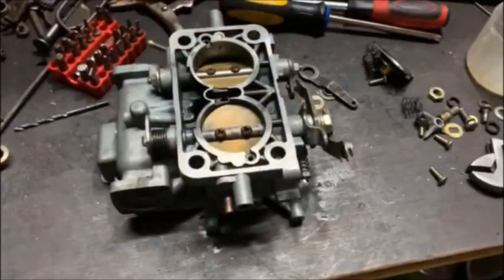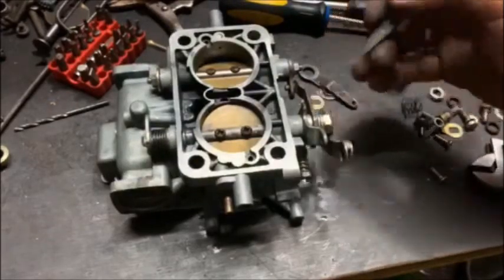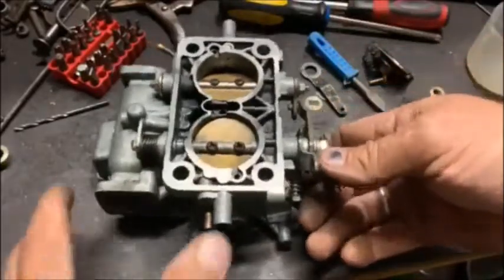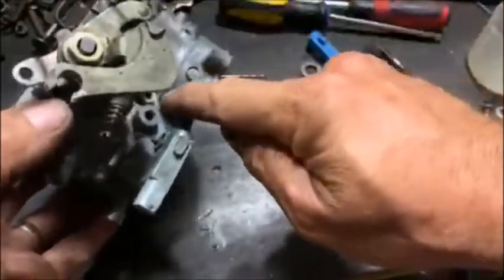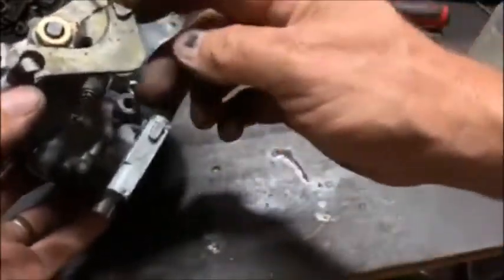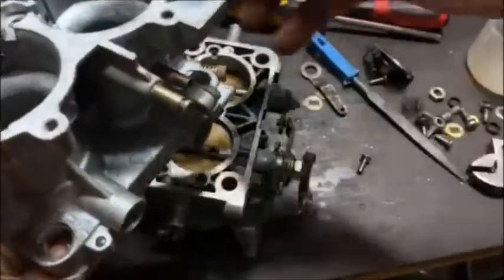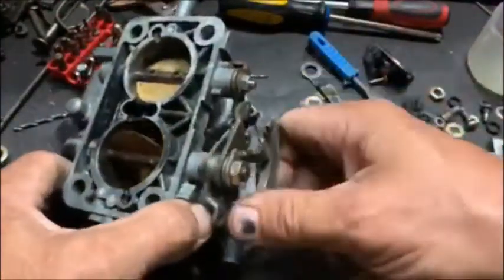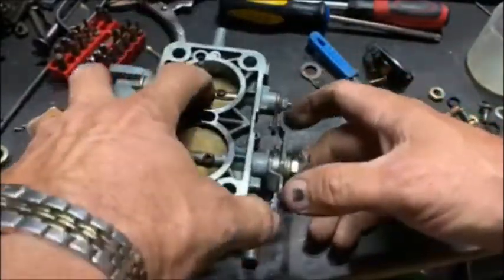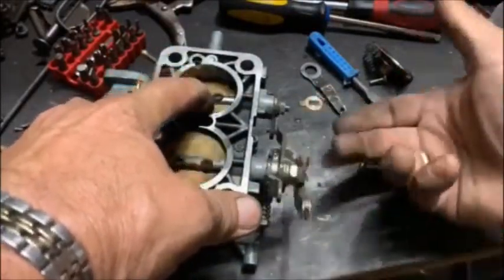On the other side, I've made that little spacer shorter — it's behind there now — and I've put this on just to see how it'll work. So far so good. Obviously there's no return spring on the 36 side — there's a pin that comes out of here and that's got a space for the spring to hook on, like this pin here. So that carb doesn't have it; I must make something up for there, but I'm not stressed about it — I'll easily do that. But there we are — 38 DGAS progressive carb. I think it'll work.